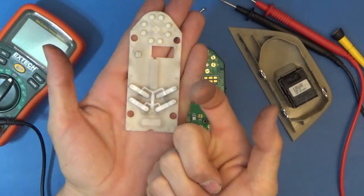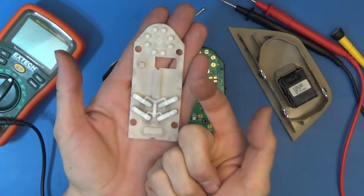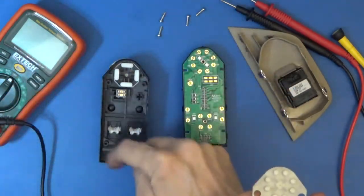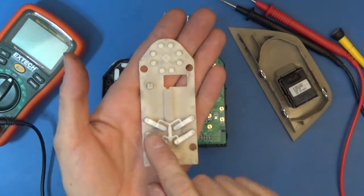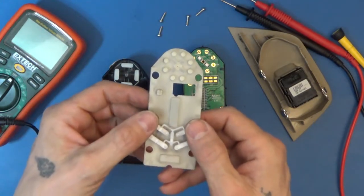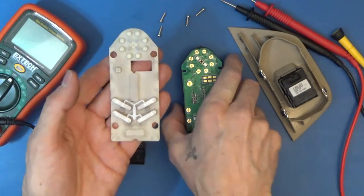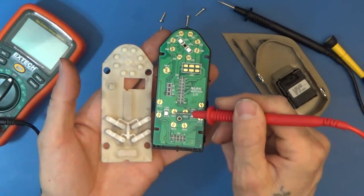So the switch itself has a halfway and then a full-on button. If you want it to go down, you push a little bit forward or all the way. If you just give it a pop, it'll just roll up all the way by itself. How does that end up happening? They've created a mechanical delay mechanism — on one side you have your up and down tap, and your up and down full, and depending on how you push it, you'll hit either this set of contacts or that set.